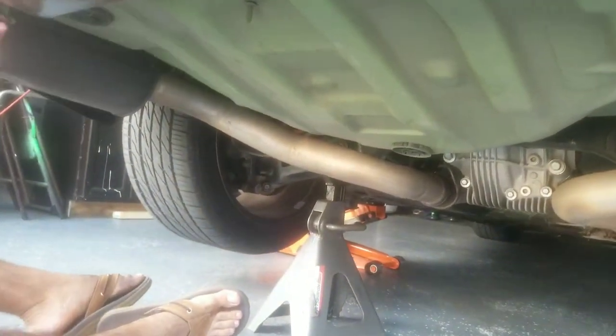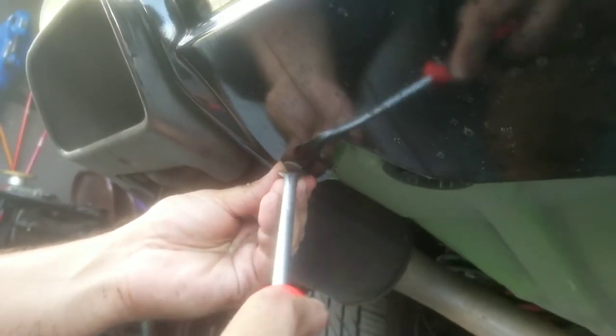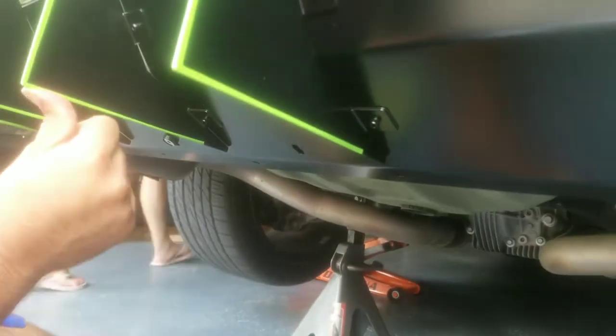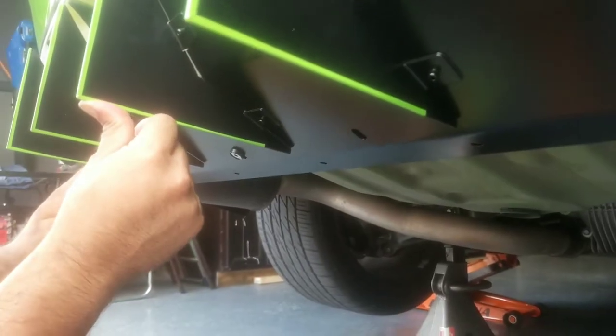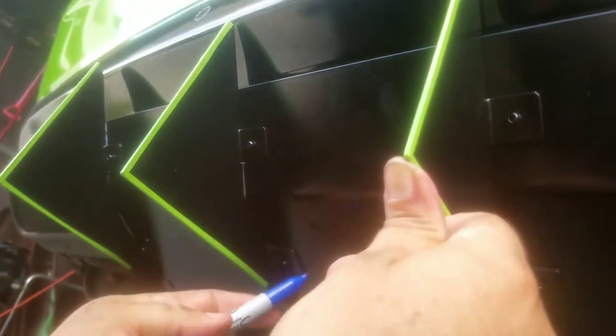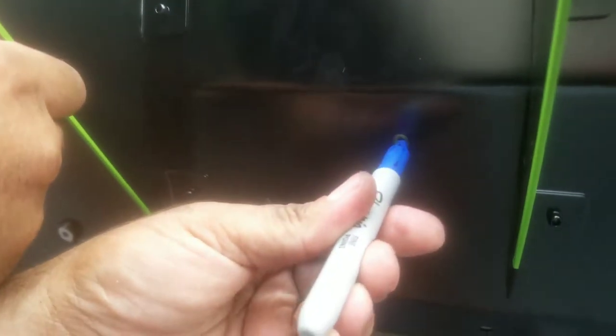What you've got to do is pop these clips out — that's where those little clip popper pieces come in handy. What I did: I put some masking tape down on the ends before I put the diffuser on. I put two of the bolts in, loosely tightened them up. You've got masking tape on each one of these outer holes right here. You're actually going to be drilling in, so take your Sharpie and mark the holes where you need to drill.